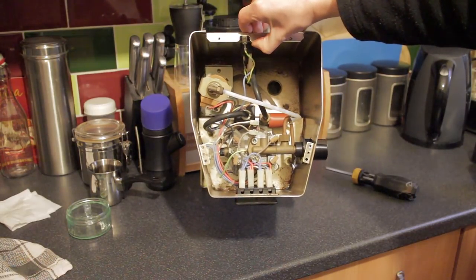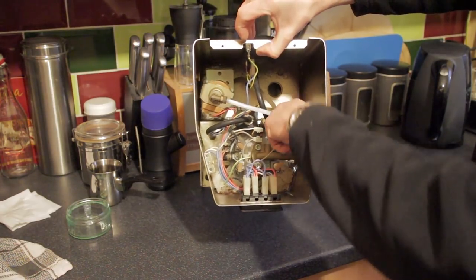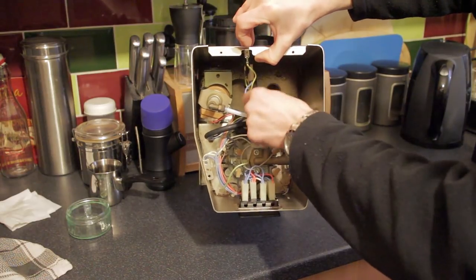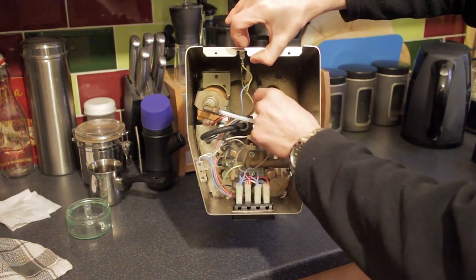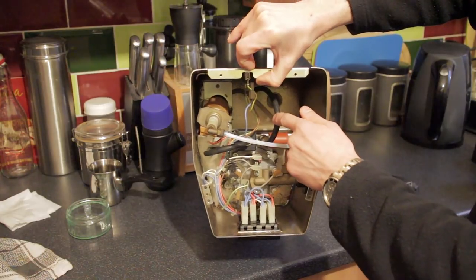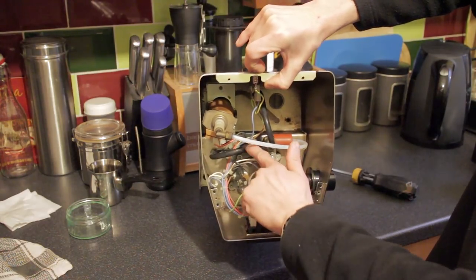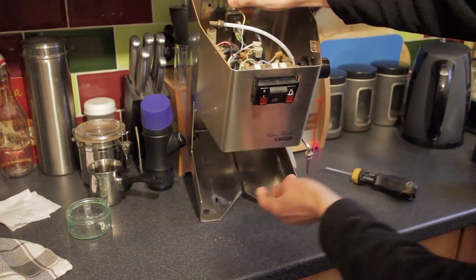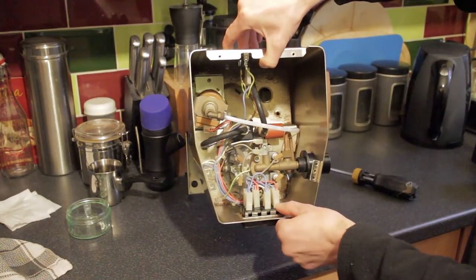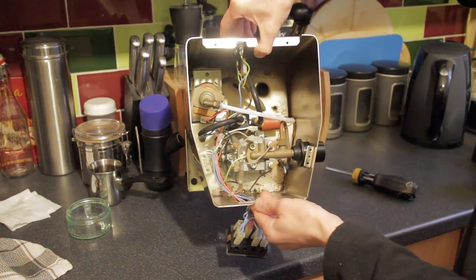Over here is your pump, which pumps water from your tank down through this pipe and into your boiler - this aluminium lump right here. You've got a three-way solenoid valve with the overpressure valve that pumps water back into the reservoir if pressure builds up too much. This gives you your nine bar pressure at the pump head. Then your solenoid valve here is a pressure relief valve that takes excess water from the top of the puck and spits it down this tube. Your switch assembly at the front has two springs which you press in and push forward to pop it out for more access inside.